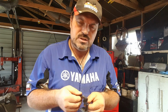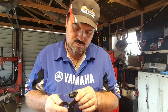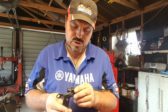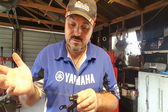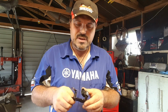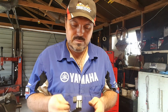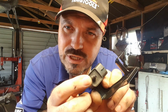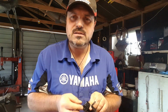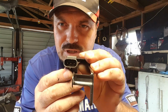This is a Toyota one, pretty common actually, off the 3SFE engine, RAV4, 1995, that sort of machine. This is part number 89420-42010. These are really common in the 90s Toyotas, used all over the place. They have an input, which is vacuum. That's a vacuum pipe from the intake manifold. And there are 3 electrical terminals just there.